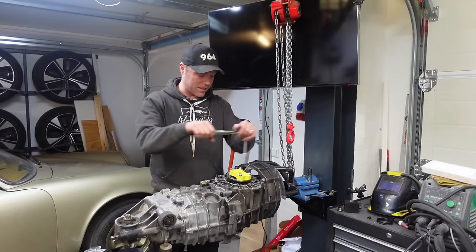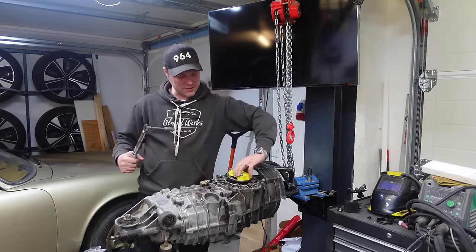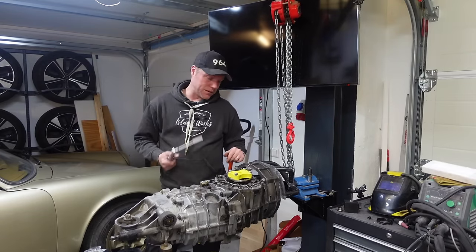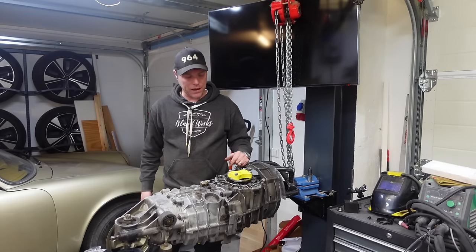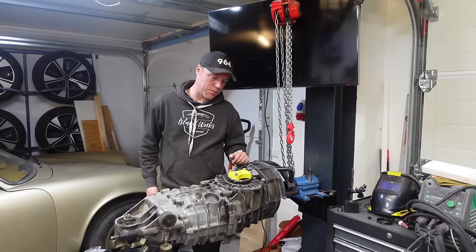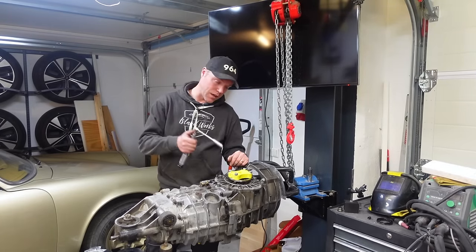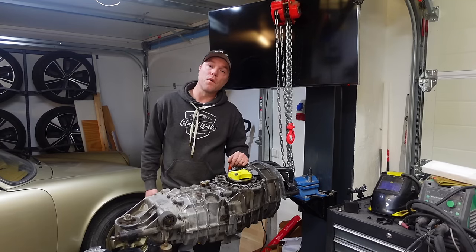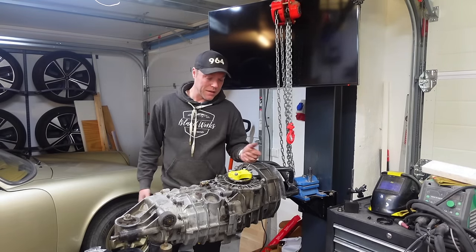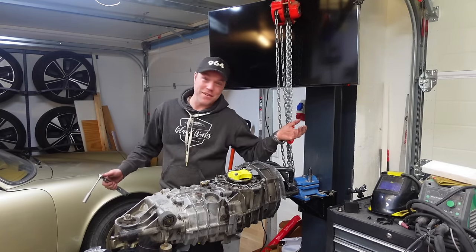This is super delicate — you must push the brand new bearing off without touching the roller cage. There's a little groove on each side that should fit perfectly. We are in good shape — perfect shape. Two millimeter washer off, now insert 2.85mm exactly. Like any sane mechanic, I want to check this. I ended up redoing this three times because there was still clearance each time. Now I have 2.6mm on one side and 3.4mm on the other. Now comes the tricky piece: the bevel gear needs to go in and I might have to redo everything again.